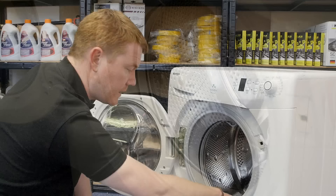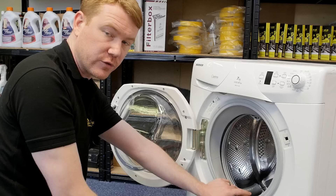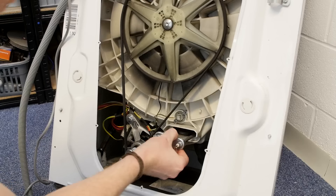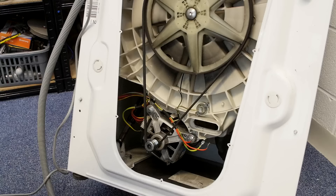If you've been unsuccessful in finding the object between the inner drum and the seal, it may well be that it slipped underneath the drum. To access underneath the drum you're going to have to remove either the heater or the sump hose to find the object. I've just removed the back of the machine and I'll take the heater out to show you how an item could be trapped in the heater itself. And there we can see the item. If you haven't found it on the heater, it's worth taking a torch and having a good look inside the heater housing to see if anything's inside.